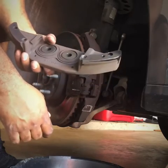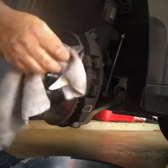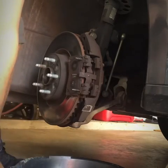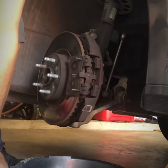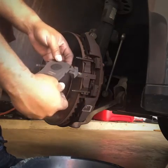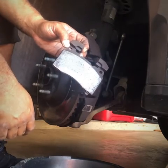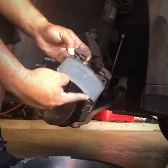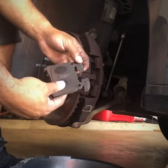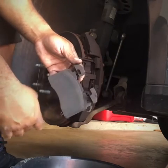The pistons are pushed almost all the way back flush. I'm going to wipe this off, making sure that O-ring is still there. You could use some brake parts cleaner to spray it clean — make sure that O-ring stays in place. You can see how massively huge these are, and I love how it says Camaro on it. Now let's see if I have the right brake pads. This is the old pad — you can see how low and worn it is. I've had this car for two years, got it in 2018. The pad is really worn low. There's the wear sensor. The aftermarket setup looks a little different — hopefully it still works.